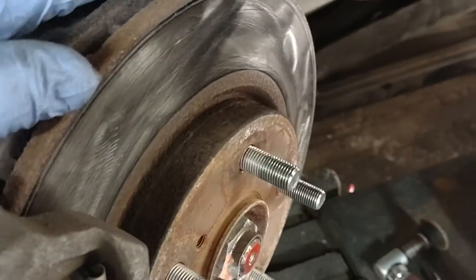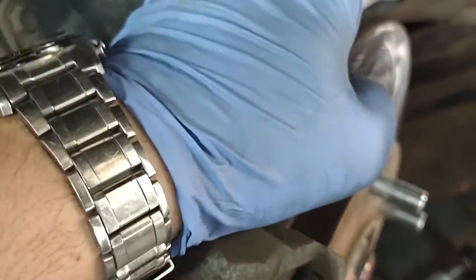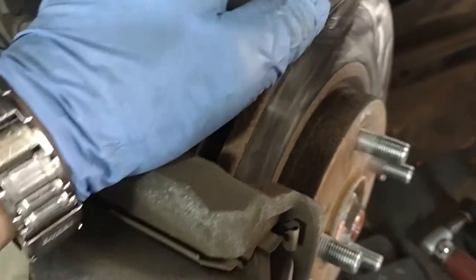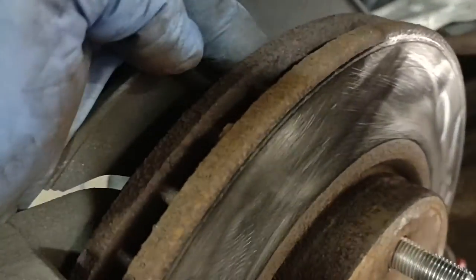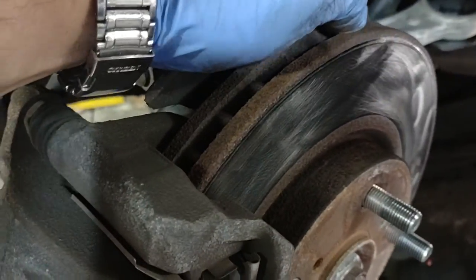You also have to inspect the brake disc. If it has more than three thousandths of an inch runout, you have to cut it or replace it — if it has enough thickness you can cut it. In many cases I give the customer advice on whether they want to cut it or not. If I see too much runout or it's worn out or there's a big groove, I ask them to cut it or replace it. In this case today I'm just going to keep the same brake disc; they don't have too much runout in them.